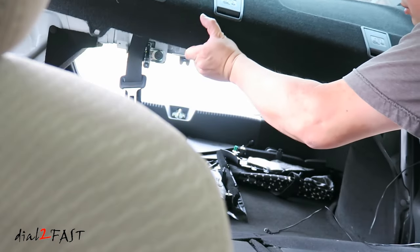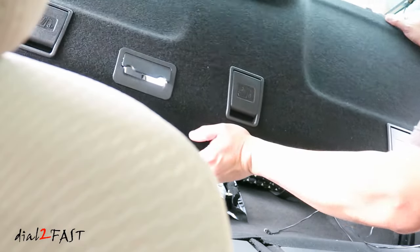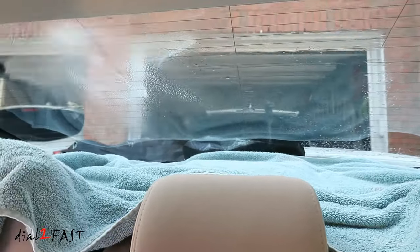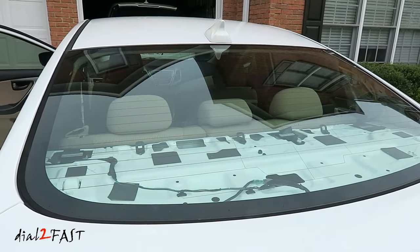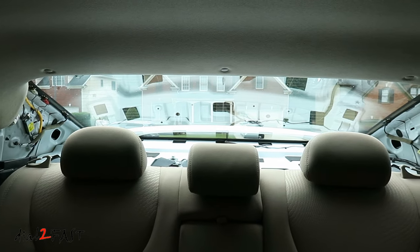Now in this vehicle, to make the cleaning a little easier, I went ahead and removed the rear deck. This way I will get better access to the corner and the edge. Then all you have to do is spray the solution onto the glass window and let it sit for about 10 minutes. Using the white scotch pad, work one area at a time and scrub the window. You'll see the adhesive come off — wipe it down with a paper towel. The last step is to clean the entire window with a good glass cleaner.